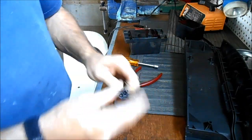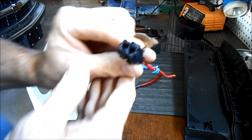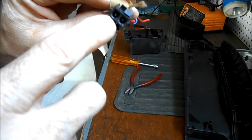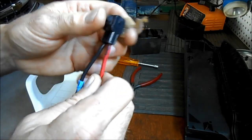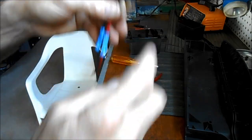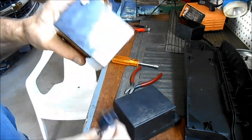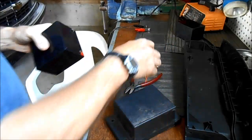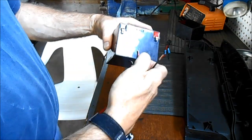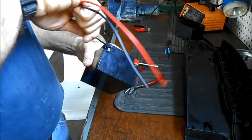And what I'm going to do — this connector, I believe, is also part of the problem. If you look down inside here, the red one is further recessed than the black one. And also I was fiddling with this before — it pulls out. So being as we already have a connection here and a connection here, and eventually a future connection to the studs on the battery, I'm going to eliminate both of these. I will just put spade connectors on the end of these like that, and then splice onto the other end of the connector that's on the lawn mower.